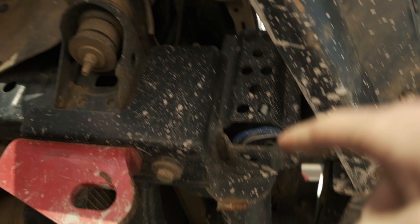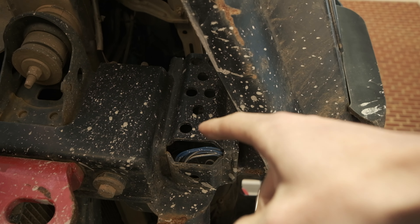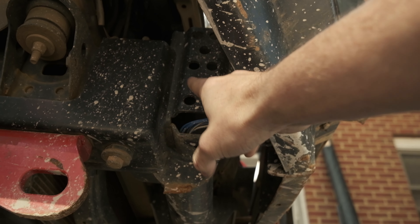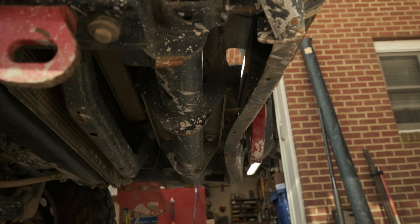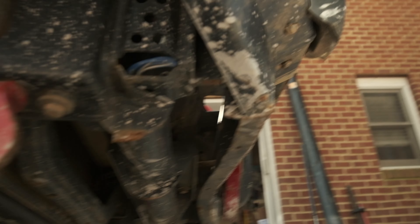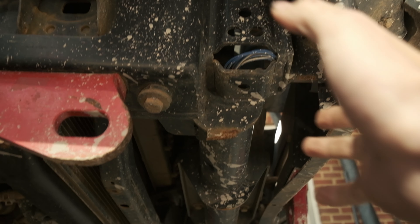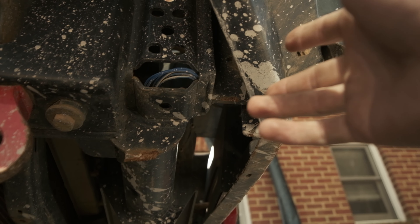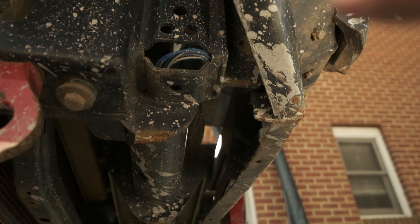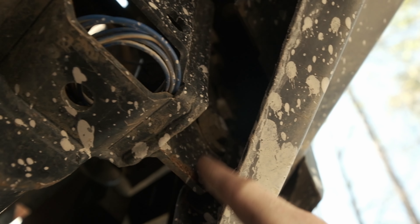It's not designed for high clearance, but it is pretty stout, and it's rated for airbag safety in Australia, which is why there are these crumple zones here and one on the other side. But if you want to reinforce it in such a way that it will not just fold in all the time, you've got to make it essentially less safe for the road. So it's a balance of what you're looking for in a bumper.